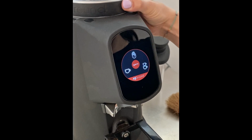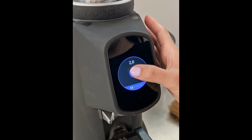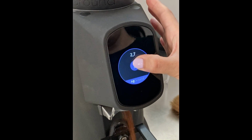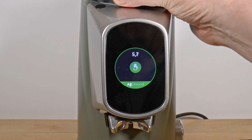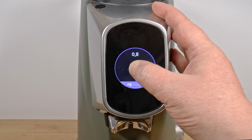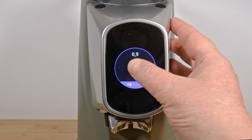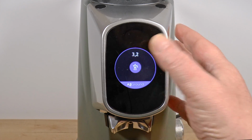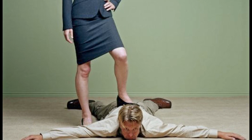I asked my lovely wife to test both grinders, which she did. She went back and forth between them numerous times, hunting around in all three ranges, and she could not make either of them misbehave. Not even once. But I often did. Next, I tried operating them myself with a very carefully placed fingertip, and sure enough, the problem vanished. Apparently, if your skin overlaps the area around the target, you get a canceling effect. Target areas are a convenient size for women, but not men. So how's that for a silly problem? A sexist touchscreen. So there really isn't a problem after all.